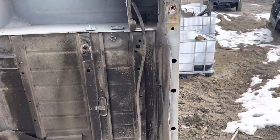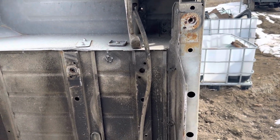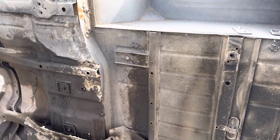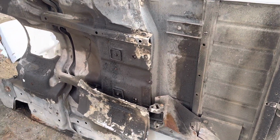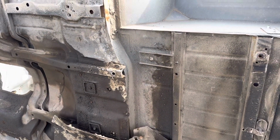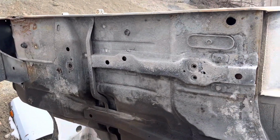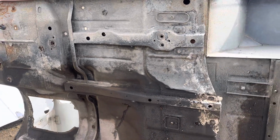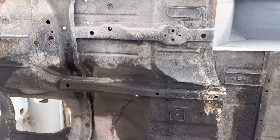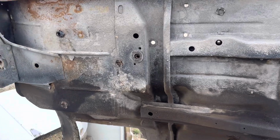And these are really hard to tell if they're bad just looking at a Jeep, because you've got a sandwiched bushing or body mount. Big rubber bushing. There's 2 of them, and they sandwich together, and then the bolt goes through them, so unless you're pulling them, it's really difficult to see. If you're in a Rust Belt area, anything basically east of Colorado, or you're in an area they use salt, more than likely you're going to have this as an issue, and you're not going to be able to see it until you get the Jeep home. So just be cautious of that.